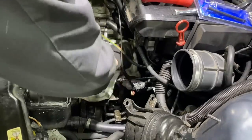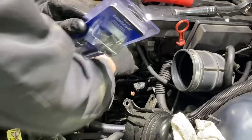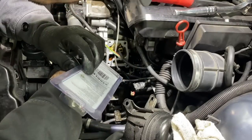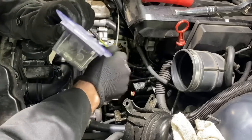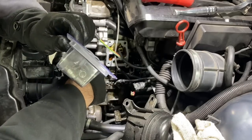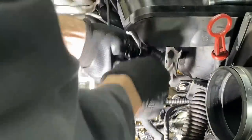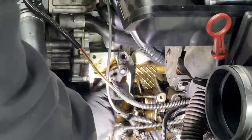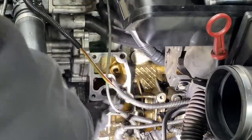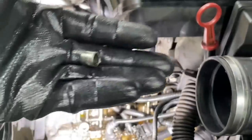But we're gonna do it right, we're gonna do it to the best of our ability, so we're gonna have to pull this dowel out somehow without damaging it too much. So I'm gonna work on trying to get that dowel out and then we'll have to drill it, tap it, put a helicoil in and hope it holds. We'll get this valve out of the way, disconnect this line. Okay, cool. The dowel is out. Now we can start working on the hole.